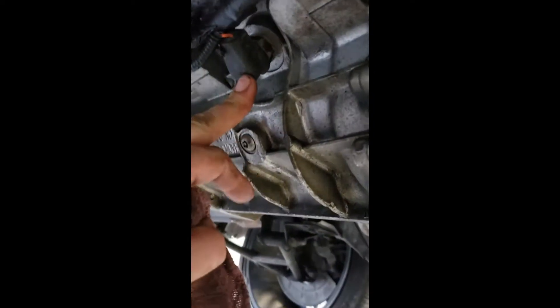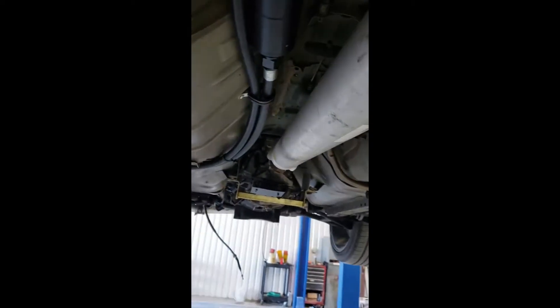With the tubular K-member it doesn't take up as much room as the factory K-member. Now we're going to remove the driveshaft. Always mark your driveshaft before removing it because you want to keep it in that same orientation — if you have it off 180 degrees or whatever it might cause a vibration. These are 12 millimeter 12-point sockets. It really helps if you have a wiggle socket to get those, and then on the transmission side it just slides out of the housing. I'm also going to remove the wiring harness that has the O2 sensor plug-ins, your reverse lights — and then we do have to go back up top to do the shifter.